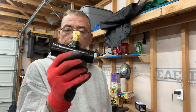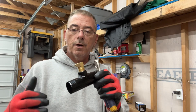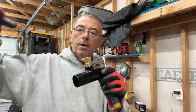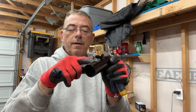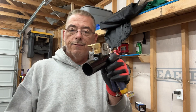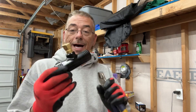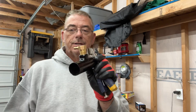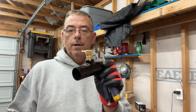If you don't know what this is, this is an insert for the auxiliary fuel system for a diesel truck, where you can run an auxiliary tank in the bed of your truck and then you have a hose that runs down to this and it puts fuel directly into your fuel neck behind the gas cap. I hear it all the time that this is a check valve that will stop your fuel from overfilling your main tank.